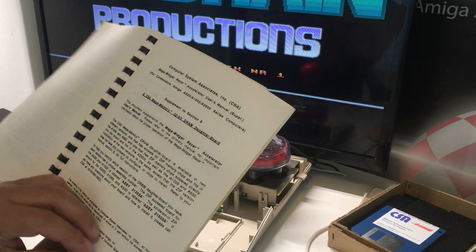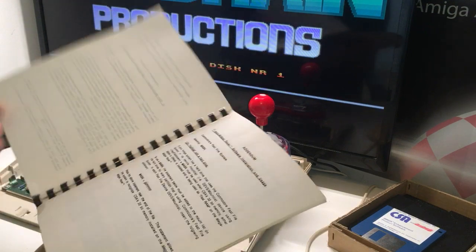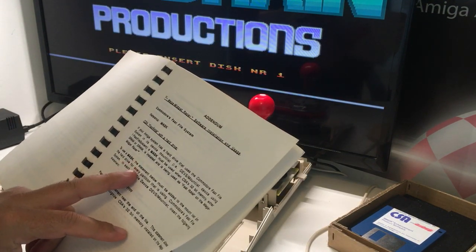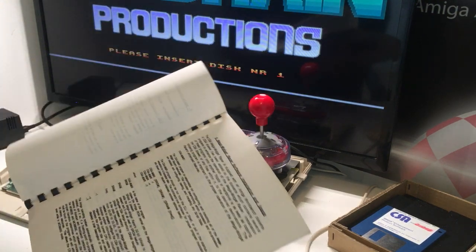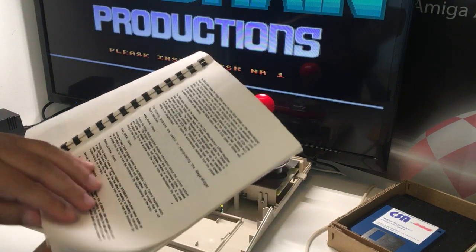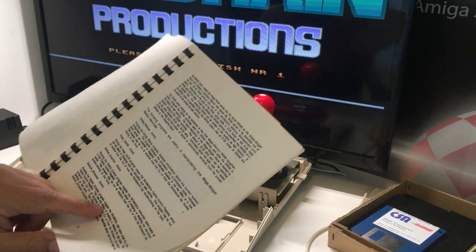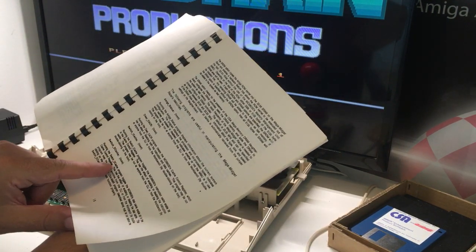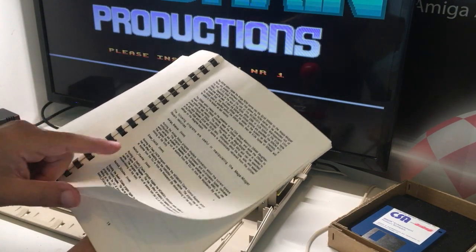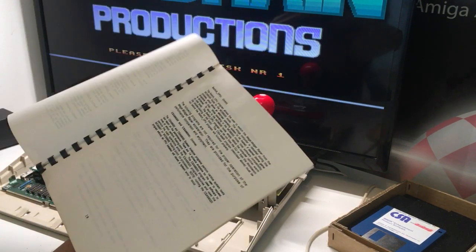This is the daughter board. I'm looking for some pictures too. Fast RAM card, 32-bit memory. This is the 030, guys — so it's not 16-bit. This is the Amiga 500 as a 32-bit system now. There's a switch where you can take D-cache and I-cache on and off. Very nice — you can run those off.